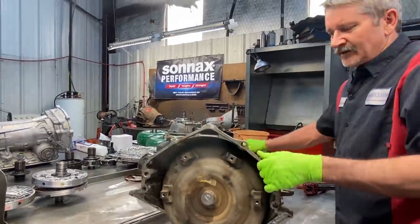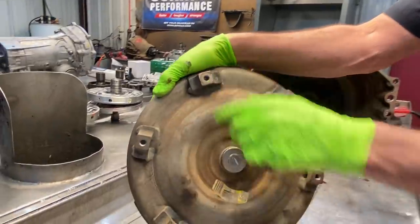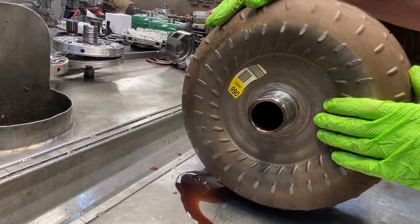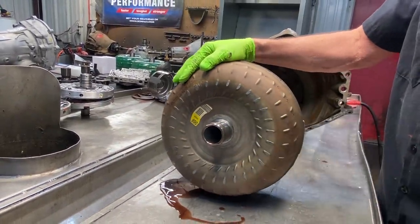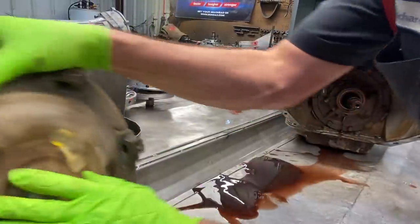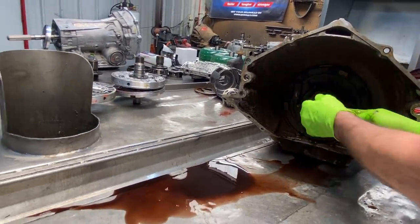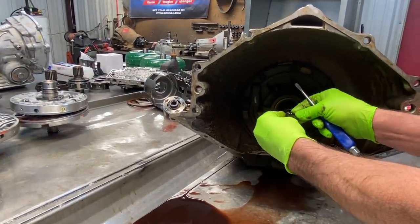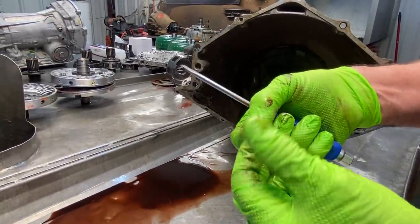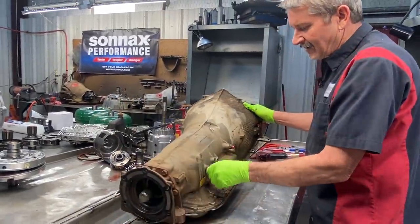Boy this thing's heavy. Big old ugly converter in here — you're talking about massive. Now they made two different versions of this converter — the B81 and B82. They made one that is really hollowed out in the middle, it's a lot lighter, but they will interchange. There's a little bit of wear on the hub with the bushing. The fluid is very nasty. We have a lockup O-ring here — it's pretty much not even round anymore, it's flat on the edges. So you always want to replace that right off the bat.